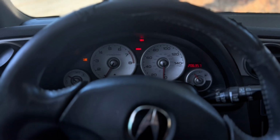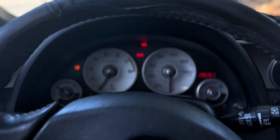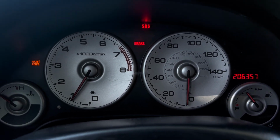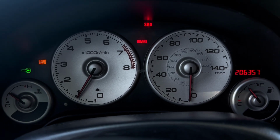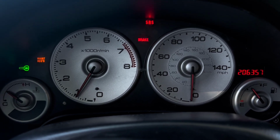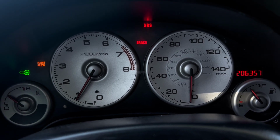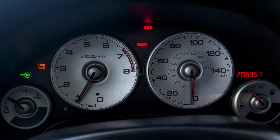Driving around a little bit. Let's get a couple clips of the two-step. So this one, I do have it set up for, I believe, 6100 to max 6300 and negative 60 ignition. I do still have the catalytic converter housing. The inside of it's actually blown out, so it's technically just a straight piped K20.